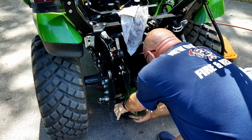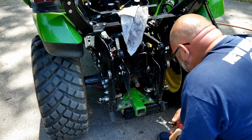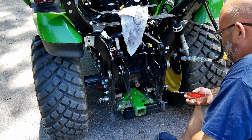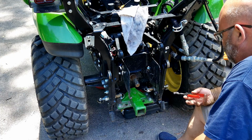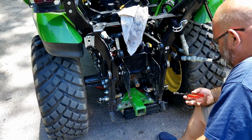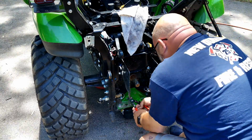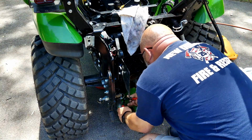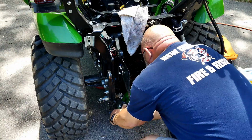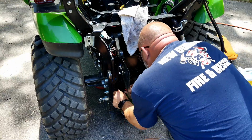And of course, these aren't staying clamped. It's a 6mm Allen head to get the strainer out, and I'm gonna use a hammer to tap that in because that's got paint all over it, and that won't fit good. If you round that out, it's a real pain in the neck to get it out. I had this on here good. Oh.